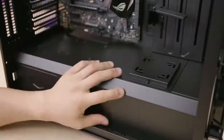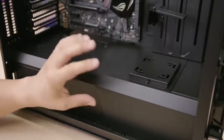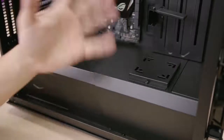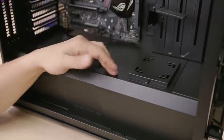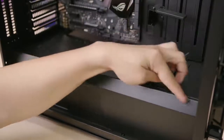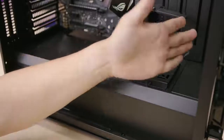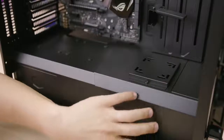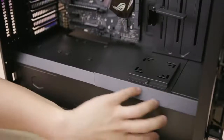There's a front piece hiding the hard drive cage underneath. Removing this piece, as well as the hard drive cage, opens up additional clearance for radiators and fans at the front of the case. On top of the hard drive shroud, you'll find a removable bracket for custom water cooling pumps held in place by two screws, as well as a radiator lid that can be popped off so you can have additional radiator clearance at the front without fully removing the hard drive cage underneath.